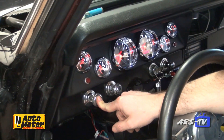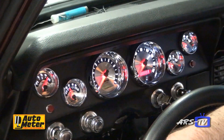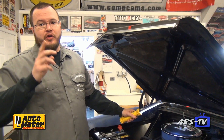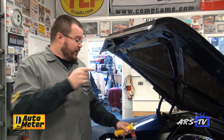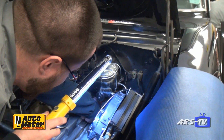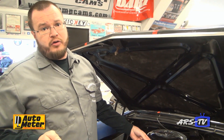Now that we've got everything hooked up, we're using a temporary ground to test everything before we finalize the wiring. By the looks of it, it seems to be functioning as expected. One area that we definitely practice what we preach on these vehicles is the grounding of the gauges — the accuracy of your gauge is only as good as its ground. As we all know, the best ground anywhere on the vehicle is the engine block. Corey's passing through the ground wire, and we will ground this up to the engine block for the best possible result and the most accurate gauges.